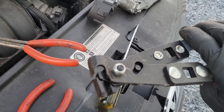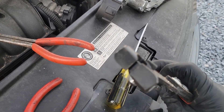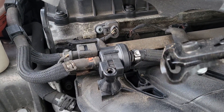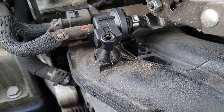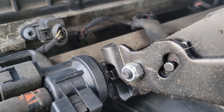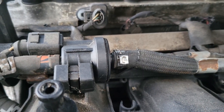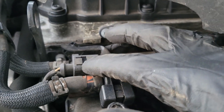This tool has a couple of different spots — you can grab it from the top where you can see the teeth, and some of these tools have two sides: one for straight-on access and another side-grab feature for funky angles. This one is vertical and straight on so it should be pretty easy. Get the tool over the square, give it a press — don't go crazy, just like a regular hose clamp. Crush it down. It could have been a little straighter but that'll hold nice and tight and won't be moving around.